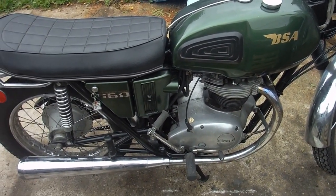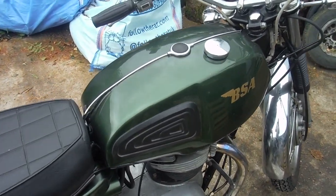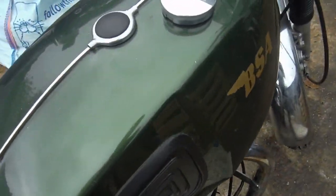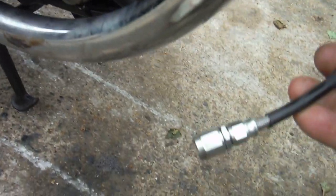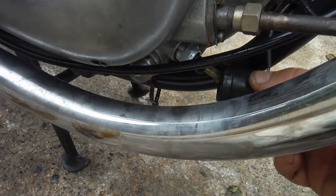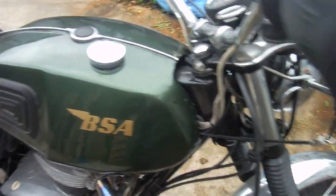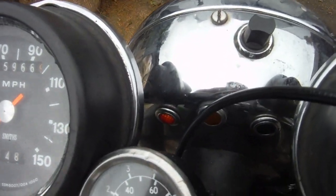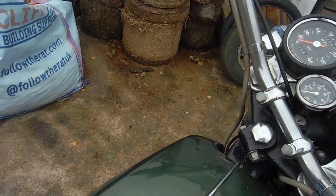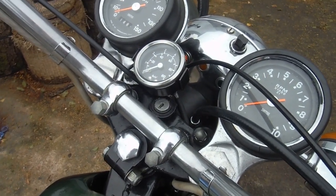Right, only within the last half hour I took a ride on this BSA A65 and came back a little disappointed with the oil pressure reading on the gauge. So I've disconnected the gauge because the owner has got a pipe there to connect up for the gauge, but there's also the original switch and wire in there, so I put that on. The reason being I wanted to see what the oil pressure light was doing, and as you can see I've got the ignition on there — the engine is hot. I'll start it up now and we'll hopefully see the oil pressure light go out.